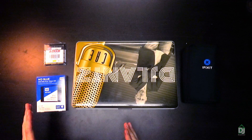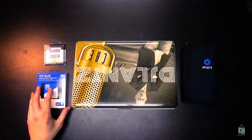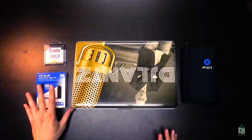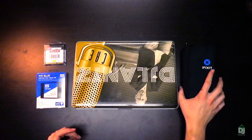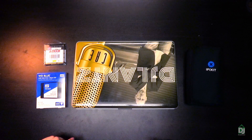Today I'm going to show you how to switch your internal hard drive over to an SSD without losing any of your data — everything staying the same as it is on your hard drive. First, what you're going to need is the SSD, a USB to SATA adapter, your laptop, an iFixit kit, or some other kit that has a 00 Phillips head screwdriver as well as some Torx bits. This Torx bit is a TR6, but the iFixit kit has everything you need for MacBook Pros.